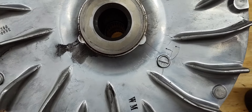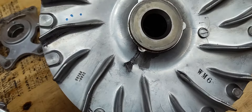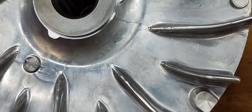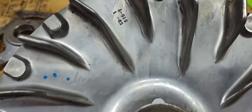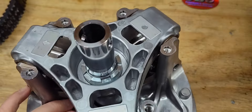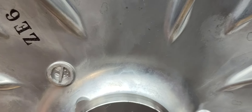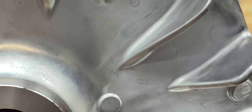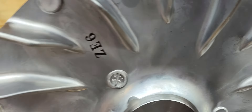The castings — you know how everybody's talking about the casting and they always have the cracks — the new KRX is the same way; has big nasty casting marks because it's the same part number as the old one. But on the Ridge it's a different part number, and you can see the casting is a lot smoother and shinier, more like a Yamaha sheave was back in the day. The Ridge definitely looks better as far as casting.